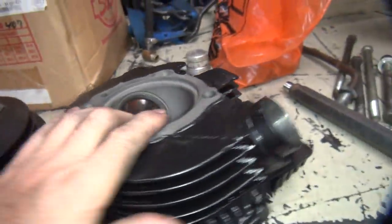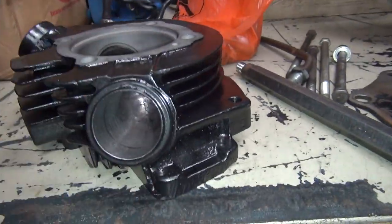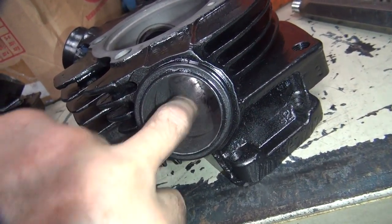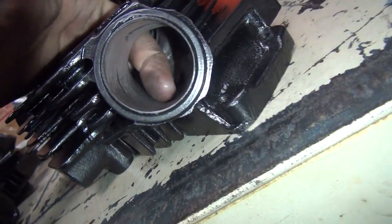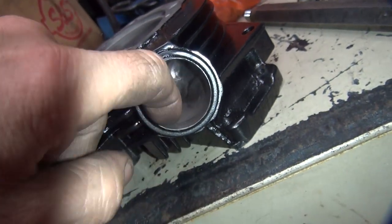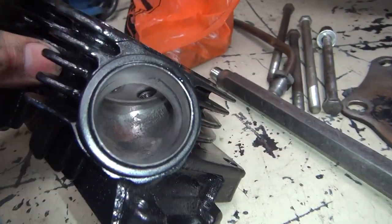So that's the stuff you cut out — it takes more time. You spend another couple of hours or so more at least on the port doing that. More time, more money. Over here we have the big lump in here, right through here — I got most all of that cut out. So now it's just a nice straight shot straight down. Then we cut this out through here and blended it into the bowl. It's a straight shot from here all the way out, and it's nice and round and smooth — not the surface finish, but the shape. There's a difference between the two things.